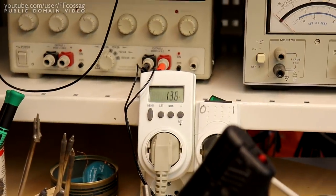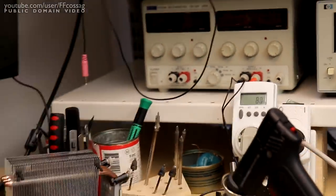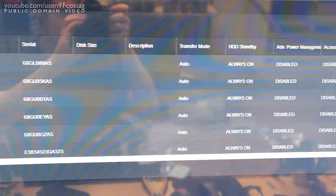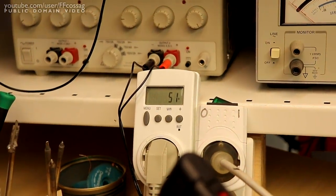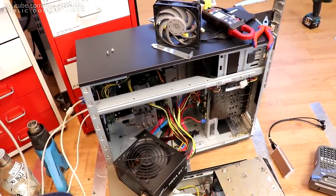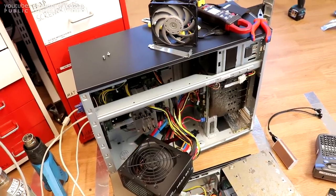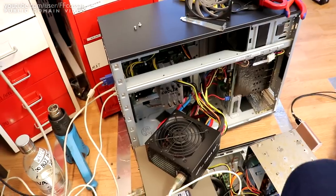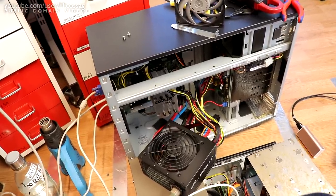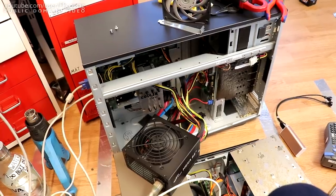We see a big spike in power during spin-up, and it seems to be booting — all drives are detected. Sadly, power usage is over 50 watts idle, and that's without the rear case fan even connected. I was expecting about 40 watts, so that's a bit disappointing. Going from one server at around 30 watts to two servers totalling about 100 watts is going to be a noticeable hit to the electricity bill.